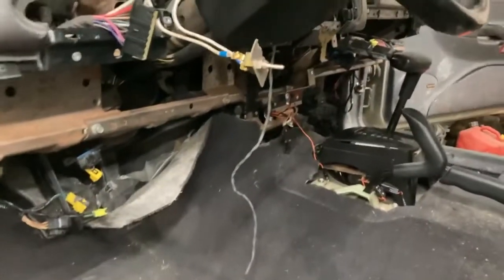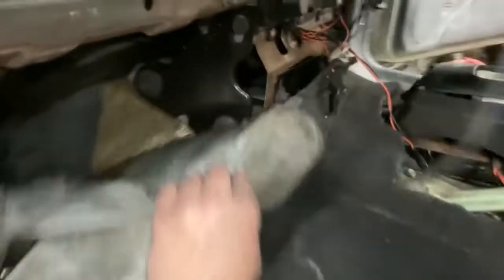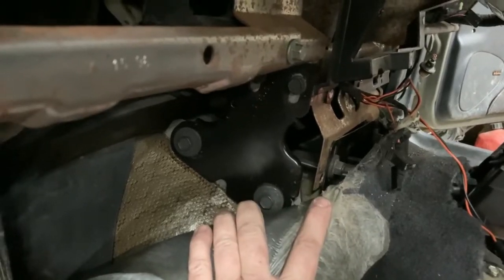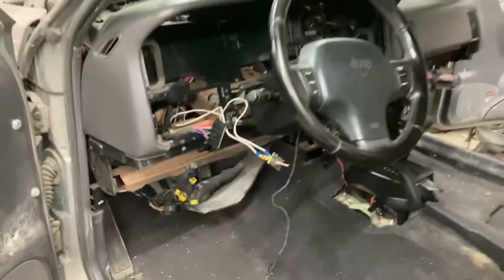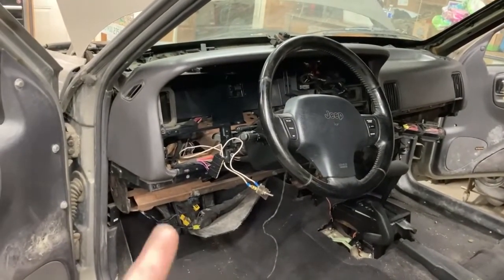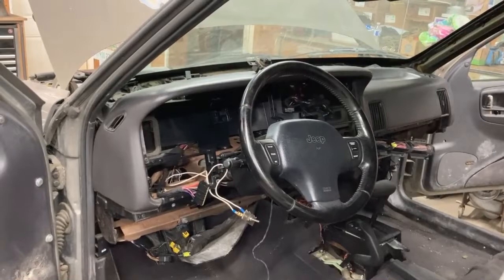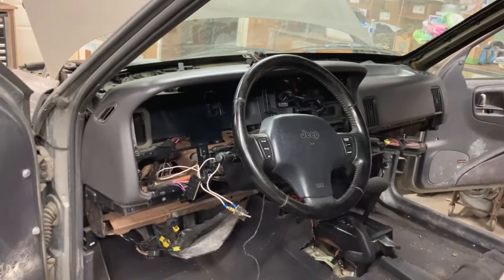Down at the bottom, brackets for the front and the side here. There's that side bracket, and then you can see this black front bracket there. Those could be 13 millimeter, but I was able to get them with a 1/2 inch. What I did was I started off with the sides. So I pushed in the sides on this side and that side, and then I tightened those first, went along the top, and then those brackets on the bottom are adjustable, tighten those down.